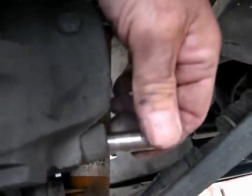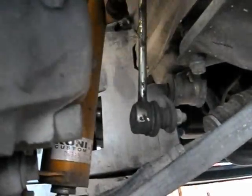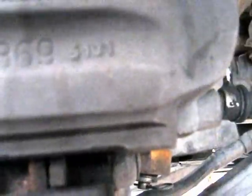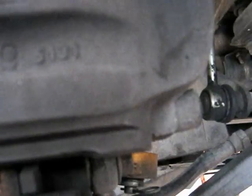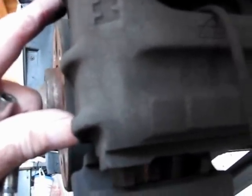These are the pins that the caliper slides on — two of them, just screwed into your bracket. The caliper slides in and out as the pads wear, hence 'sliding caliper.' The piston is only on one side: hydraulic fluid comes in, presses the piston against the rotor, and the other side just captures the other pad. It's not like a racing caliper, but it works pretty good.